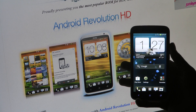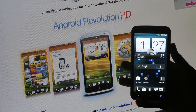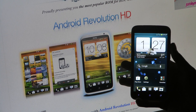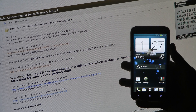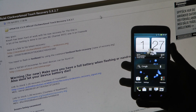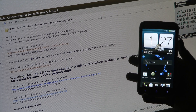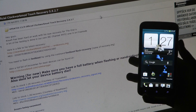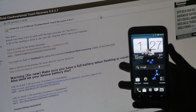I went back to the stock ROM just by going into... As you know, after I made a video on how to root and unlock the bootloader on the HTC One X, immediately after I did that, I went to Clockwork Mod Touch recovery 5.8.2.7, released on the 13th of April. I'm still running on that. After I rooted and unlocked my HTC One X, I made a backup. So go back into Clockwork Mod Touch, go back to the first backup you ever made, and go ahead and restore your phone to that.